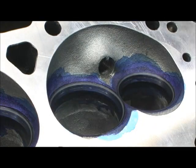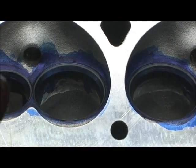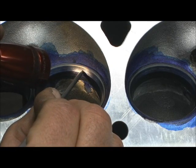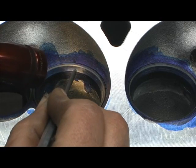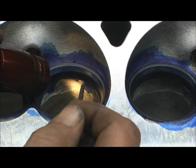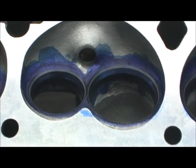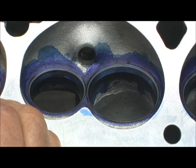That's great, I got enough of a line now to see. As you can see, I can see my line being right there. That's going to be about 40 thousandths below. There's my gray seat, which I might add came in absolutely perfect — I am going to put a run-out dial on it so you can see the numbers I got this time versus last time. On the exhaust, I'm going to reach down a little bit for them — that one's going to come in probably about 40 to 50 thousandths from the top. I get a little bit more of a radius there.